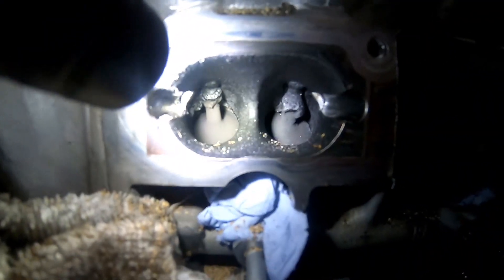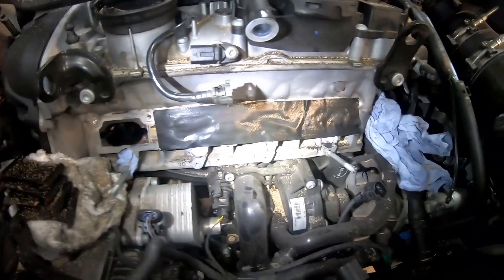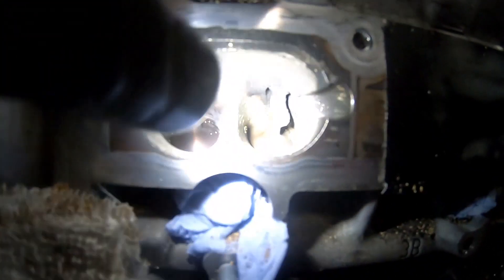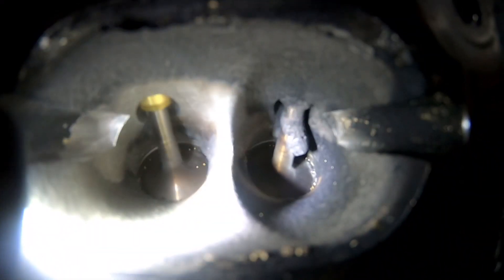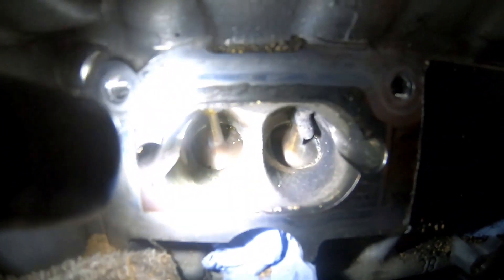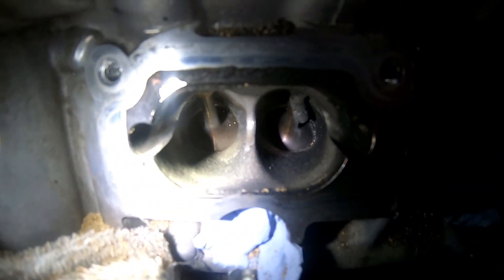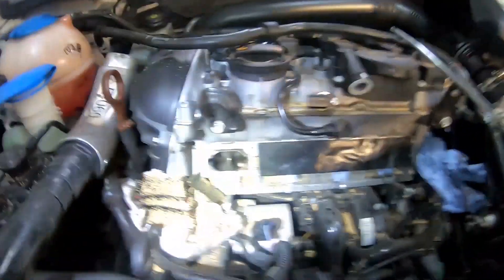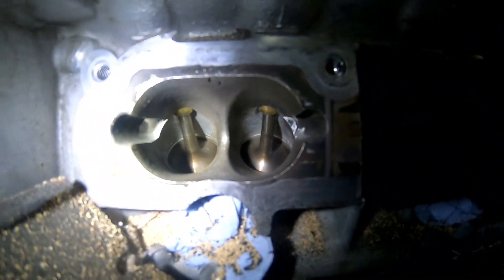So that's our before on cylinder one with the valves completely closed. You can see how the carbon build-up matches up perfectly with the valve guides, and the rest of the ports are blocked off with duct tape. That's our first blast started on cylinder one - we've already got a decent amount out, more so it seems at the left port. The harder the build-up is, the harder it is to get off. In the tip of the ports I tend to just use a light wire brush just to knock the dust that's built up there, then blast the valves again - this will probably get three or four blasts. We're now completed with cylinder one as well. You can see how clean it is compared to how it was.